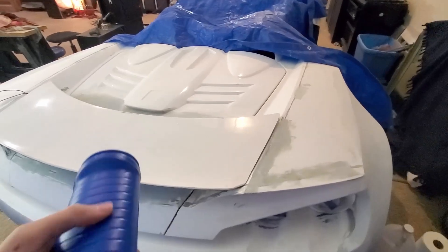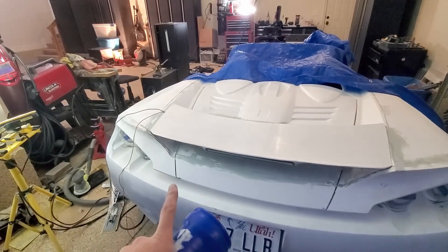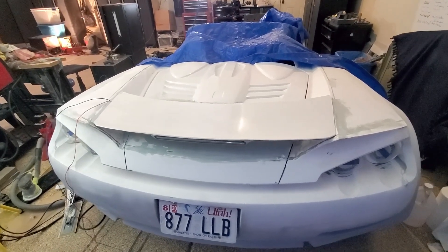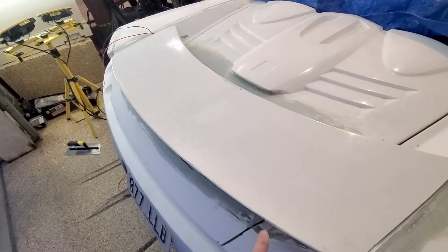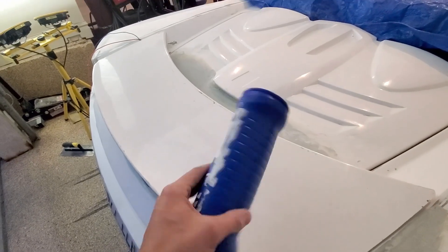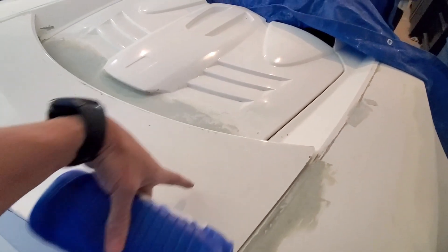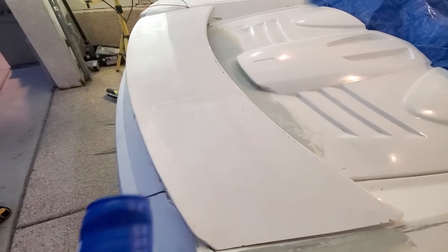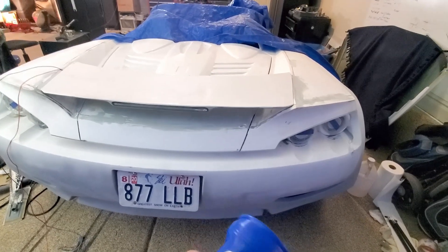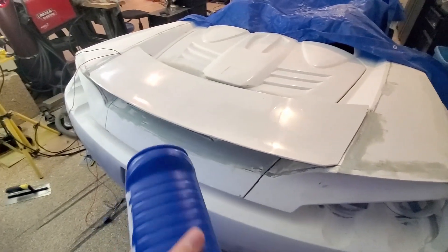Looking at mounting the wing — when I made the deck lid come all the way to the back, it cannot mount on the sides. So I'm going to create a fiberglass strut. I'm thinking about using this oval plastic piece as a form — it's a little more than half an inch across. It has some ribs that should add stiffness. It's only about two or three inches tall. This may be something we throw away but I'll give it a go.